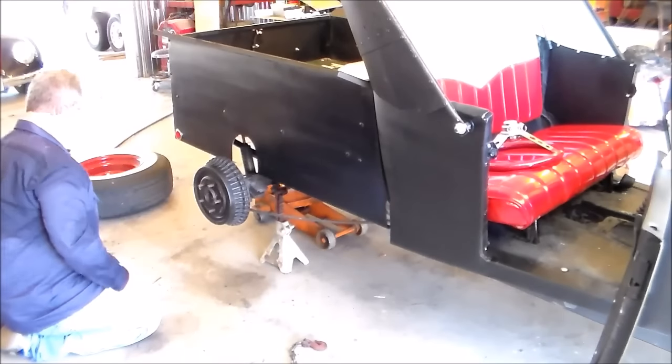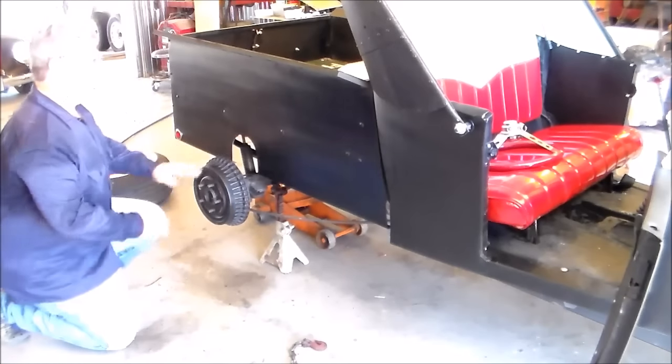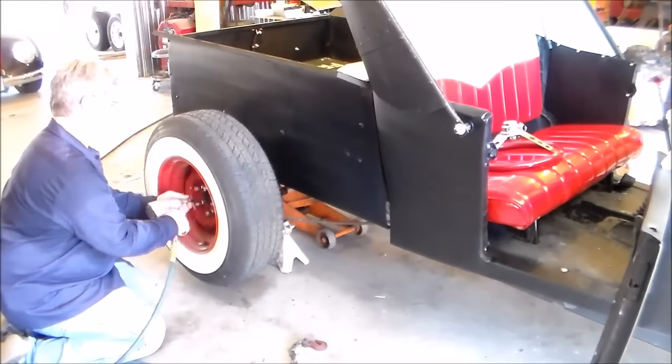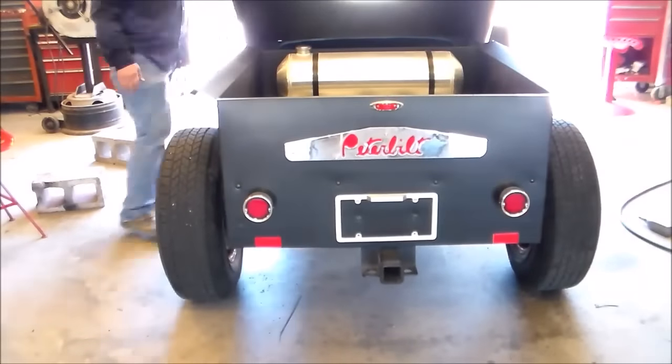Use the old meat hammer to get that brake drum back on there - probably not that good for you. Looks like we got those brakes fixed. Wasn't nothing but a loose line, tightened it up, bled it, put more fluid in it, and it looks like we're good to go. I appreciate y'all watching the Rusty Glovebox, and I'm out of here.